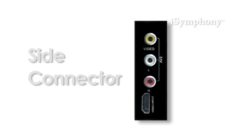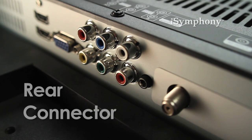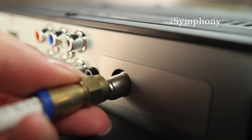Depending on how you get your television signal, there will be different types of connections. You will notice the connectors are located on the side and rear of your TV. If you are using an off-air antenna, make sure that it is digital ready. Place the tip of the cable on the antenna input and attach it by rotating the connector clockwise until it's secured. If this is loose, the reception will not be strong and may display a faint and pixelated image.